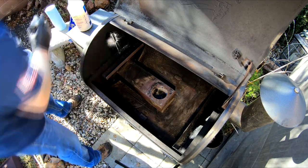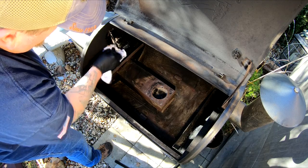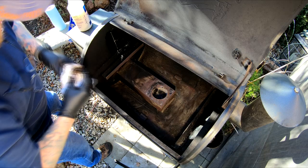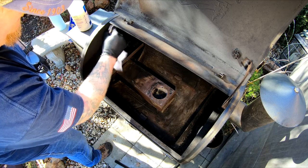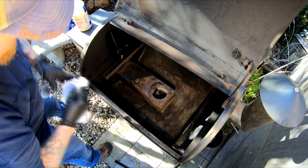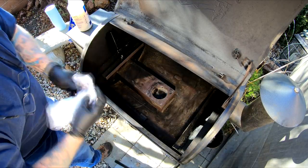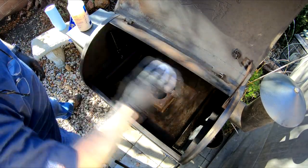I'm going to get a little bit of the oven grill cleaner. Some of you may not want to do it this way, but I like to keep that temperature probe fairly clean so that I get accurate readings. I've seen some folks take pieces of cardboard and shield them from the side — I've tried that, I didn't really notice too much of a difference. So I've been just practicing keeping it clean and avoiding any unnecessary wiggling of it, wire connections and things like that. I just give it a little wipe around the edges.